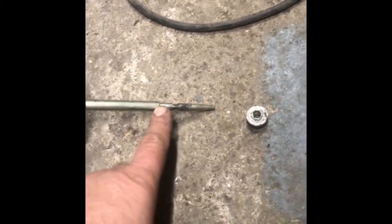That plunger gives the pedal something to push against. The intention is to cut this off, get some sleeving, and extend it out - it's probably 10mm there so I might need a small joiner between the two. I'll extend it out and replicate that fit on the end, adding a bit for the actual space, approximately the same length as the spacer, which should give me the same sort of pedal travel for an initial bite on the brakes. With the captive 8mm bolts now on the front, I can just put the master cylinder on with a couple of 8mm bolt nuts and washers either side.